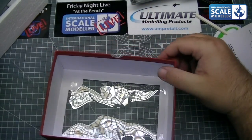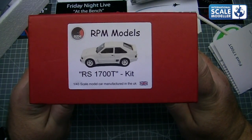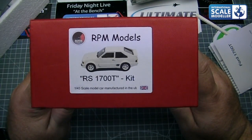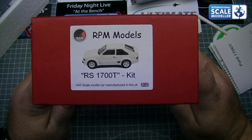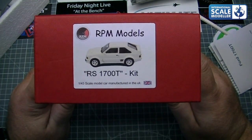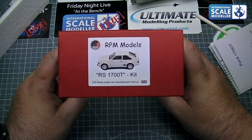Now these were Ford Motorsport took a few cars back in the 80s, Mk4 Escort, which is your little typical front-wheel drive mundane shopping car, that thing there. They were lucky to push out 100 horsepower in the XR3 variants, and about 104, 105 in XR3i. Ford took these with the intention, I think, to take rallying, and so they made them rear wheel drive, stuck a big body kit on them, and stuck a huge stonking Cosworth YB, well, the original YB, I think it was the BDL engine, I think they called it. So it's a turbocharged monster, rear wheel drive, pushing about 350 horse, and about 380 foot-pound of torque out the back end. Sadly the project was scrapped, I believe most of the bodies were crushed, which is a real shame.